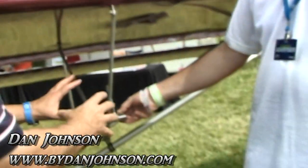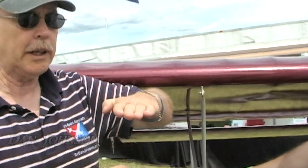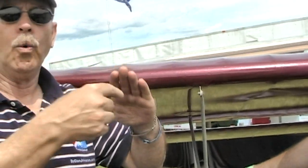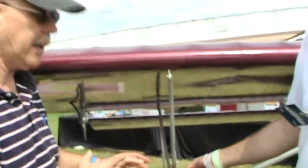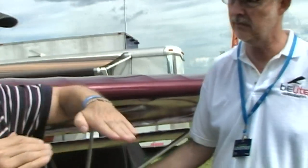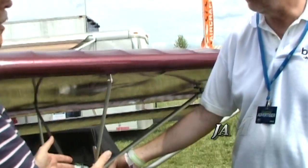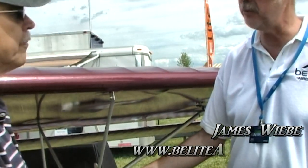To run that indicator inside the cockpit, you've got to have some equipment out here. Some people are doing this with a pitot tube that has two inlets, and as it gets to a certain angle, one inlet feels the pressure more than the other. But here's actually the way they do it on airliners — if you look on the outside of an airliner near the nose, you'll see a physical thing that moves up and down. That's exactly what you've got here, and this is exactly the same way.